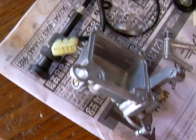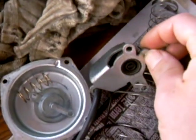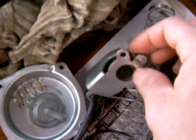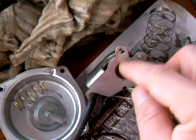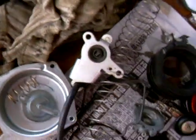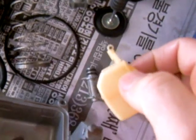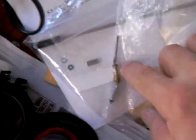When you're taking apart this carburetor, watch out for small parts so you don't lose them. For the throttle position sensor, there's a little plastic piece in there that you want to make sure you don't lose. Also, the float chamber has a small needle that comes out very easily — you don't want to lose these parts. I suggest you store them in a zip-lock bag like I did.